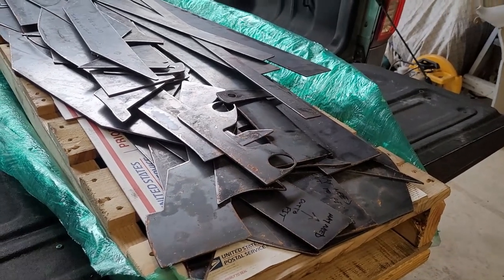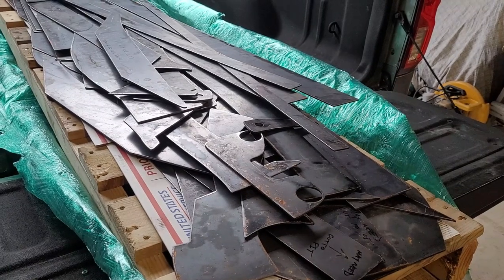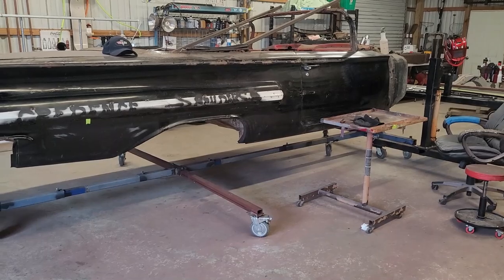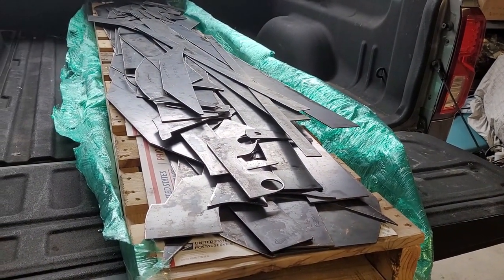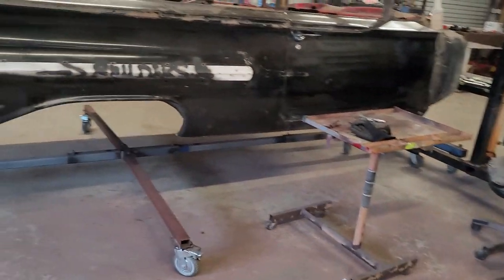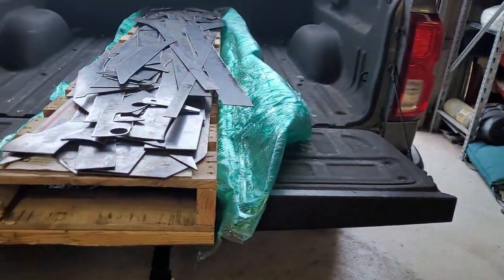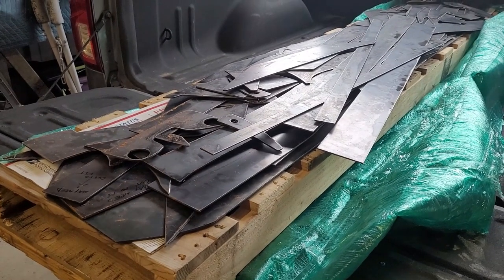I went with eighth-inch thick steel. I know there's going to be a lot of people that are going to frown on that, but I don't care. Mainly cost is one reason, and on this car that I'm building I don't ever plan for the tires to come off the ground — there's going to be no hopping. I just wanted a molded look with some added strength. The old '60 I had had an original convertible frame and I didn't even reinforce anything on it — we just did the rear arches — and I never had a problem. So I think the eighth-inch thick is going to be plenty for what I'm trying to do with this car, and it's way easier to work with.